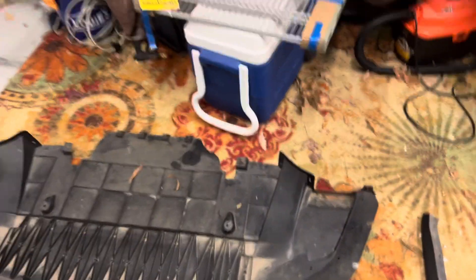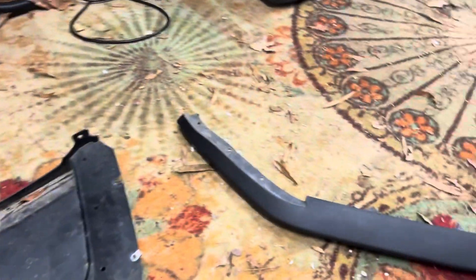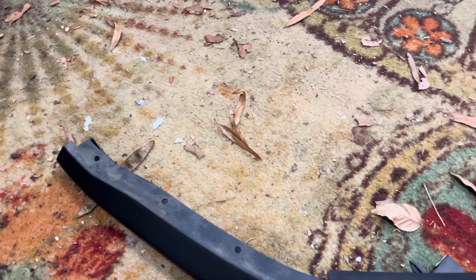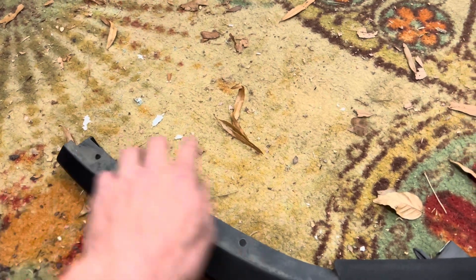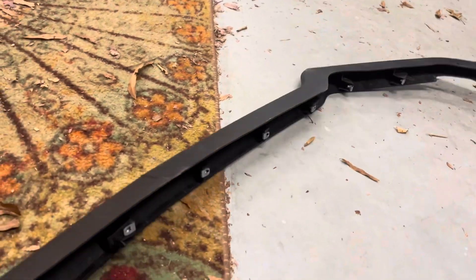If you guys can see here, I'm going to show you all of the 7mm bolt locations — literally every hole you see across the front. And then here, same thing — these three on each side are the panel clips, the panel fasteners, whatever you want to call them. Those are kind of frustrating if you can't get very high. And then all of these were 7mm going up. This lip by itself is the California Special — it's going to look much better with the double-decker MP Concepts. I have maybe about 15 to 20 of these 7mm bolts total.